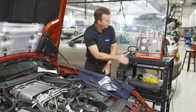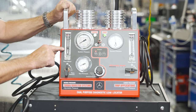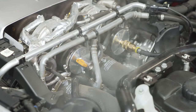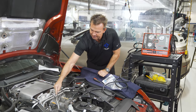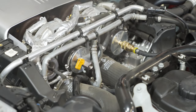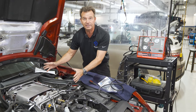With the hose connected, we turn on the smoke machine and get flow going into the system. After about a minute of the system flowing, you'll see the smoke coming out of the second bank. Simply close off the ball valve and you are now pressurizing and testing the system. You can now start looking for leaks.